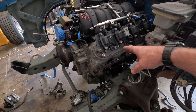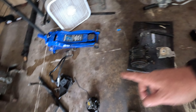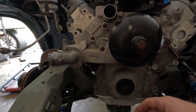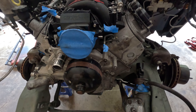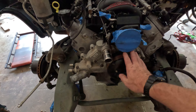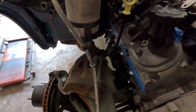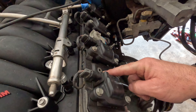The long tube headers are set up for motor mounts that have it more forward and higher, and that is not what I want. I've already talked to the shop and they're going to take them back. I've got alternators, power steering pumps, reservoirs, everything laid out trying to figure out how I'm going to do this. I can keep my original GTO water pump that came on the LS2. I think I'm going to go with ICT Billet accessory brackets because they actually have their stuff in stock and Holley does not. I got the water pump back on, intake back on, coil packs back on, finally got the oil dipstick in, put oil in the motor, and the starter is back on. Stripped a bolt - dang it.